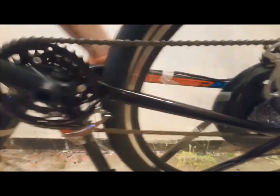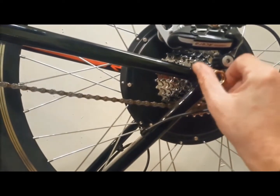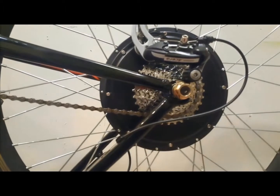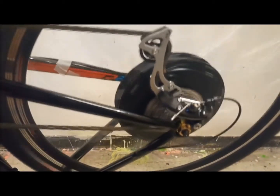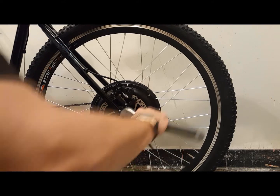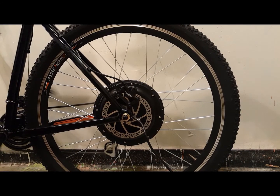Once the brake is secure, it's time to place the wheel in the frame, making sure that the wheel is true and the brake fits evenly in the brake caliper. These are very fine movements, but you can do it without much effort. It's very important that you have one washer on the inside — a normal washer on the inside of the frame — and the lock washer and mounting nut on the outside of the frame. If you get that wrong, it will not work. Once I have firmly tightened the nut by hand, I want to test that the wheel is spinning freely and true and that the movement of the chain on the cassette is aligned. I don't want any strange movement there because I need to ensure good shifting. I then firmly tighten both nuts with a wrench — not too tight, you don't want to break the frame, but tight enough because these are powerful motors and you want to make sure they're really lodged on there. Then I'm ready to install the controller and the battery.